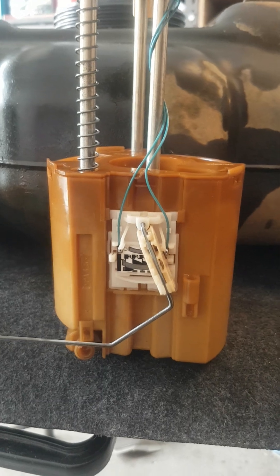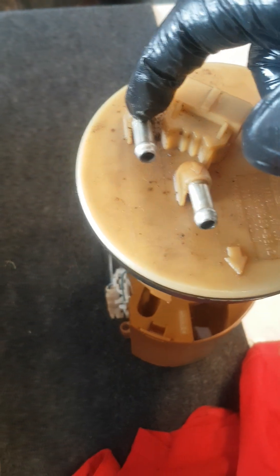What I'm suspecting is the problem is that when this unit sits in the tank it sits at about this height. Fuel comes into here from the recirculation part, and that comes out down in here — if I can get the camera in the right spot — down in this little bit here it comes out, and then it gets sucked back up the other hose, this one, up here, back through here and off to the filter and into the engine.